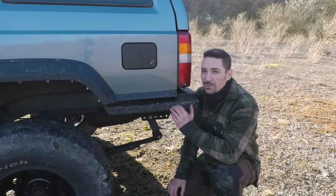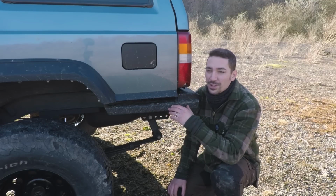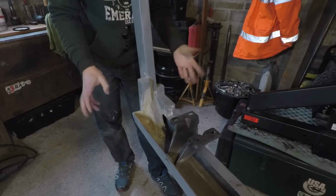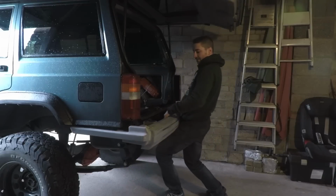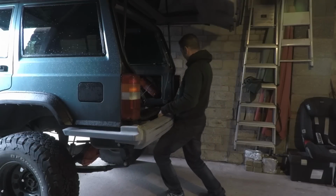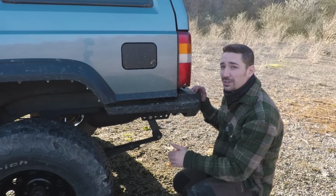But there aren't a lot of options in this country for aftermarket bumpers that adhere to that kind of change that you make. So I decided to take the stock bumper, put some baffles in it, strengthen it, and add to this box section on the outside. And you can actually high lift jack off of this now and lift the vehicle.